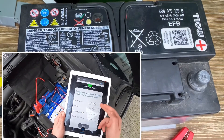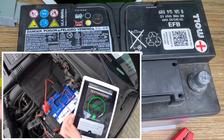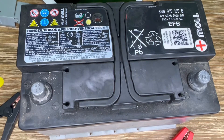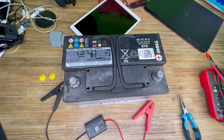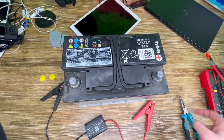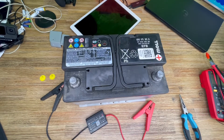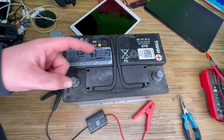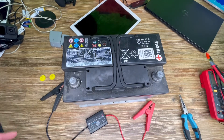You can see the new battery I installed in my car is in good condition. As you can see, the old EFB battery was really dead. So you can check it and be sure that your battery is damaged — because if you do this only with a multimeter, that is not enough today. You have to enter the stated cold cranking amps for the battery into the device, including the measurement method used. Common standards are DIN, EN, IEC, JIS, and SAE. Details of these standards can be found on the battery product data information sheet. If you choose the right current and the right standard, your tester will give you the right battery health data.